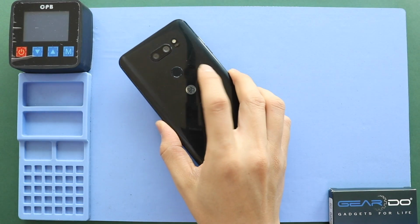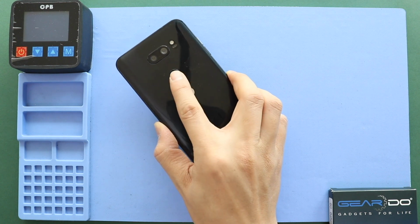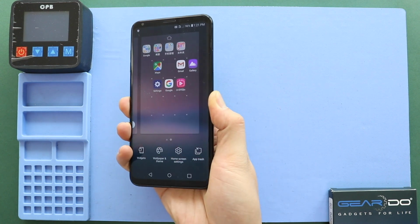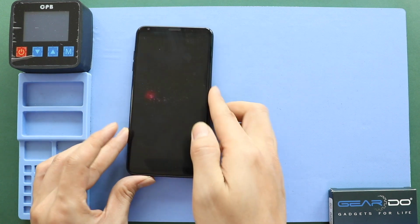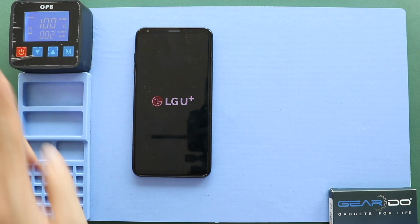Today we will show you how to replace the battery on the LG V30 mobile phone. To start, we need to have the right tools to proceed with the repair, which you can find in the description. First, turn off the phone and take out the SIM tray, followed by the back cover removal.